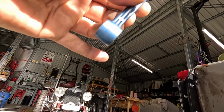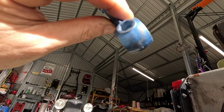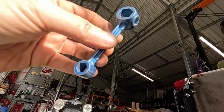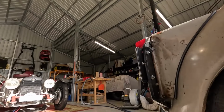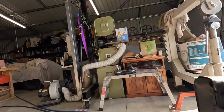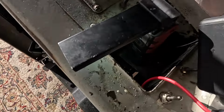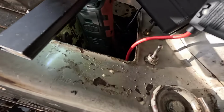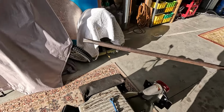Kind of looks like a connecting rod. It says made in England, but there's no marks on it. But I was able to get that onto that lock nut and loosen it, which then lets you turn the eccentric bolt. But again, getting to that is really hard. You can't get a spanner on it. So I've made up this steel bar. It's just mild steel.